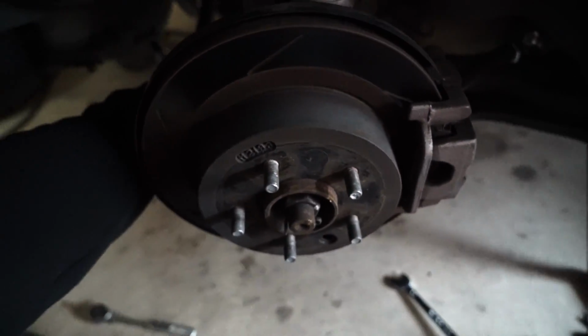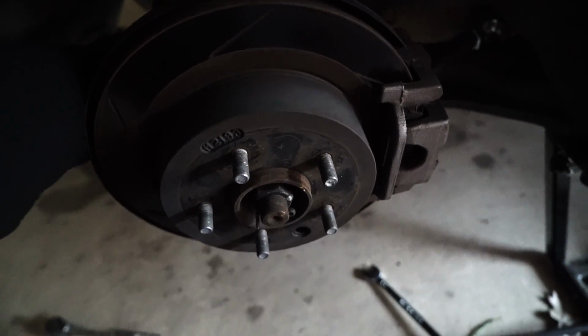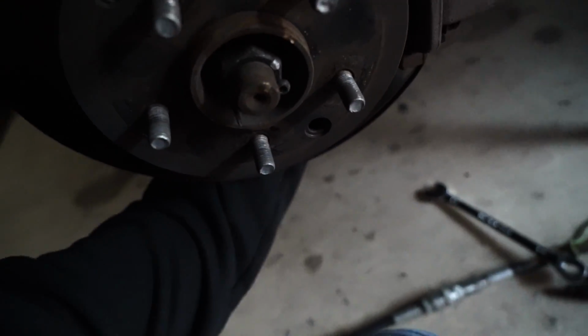So I can do everything. I can literally move everything by hand because there's such nice suspension components. Hey, if I want more toe in, all I gotta do is spin it right here, like that. Or if I want more negative camber, spin this little guy.